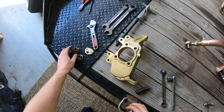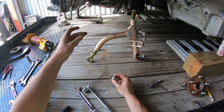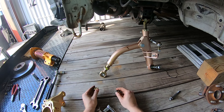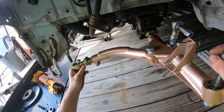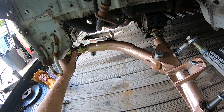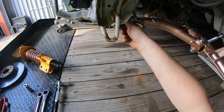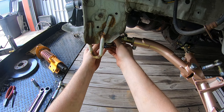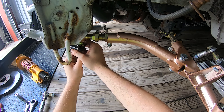For this part of the control arm we have two spacers: the bigger diameter spacer goes on top and the smaller diameter spacer goes on the bottom. This goes on like so, then we get the control arm on, then the bottom spacer, then the crossmember support or control arm support, and then the bolt.